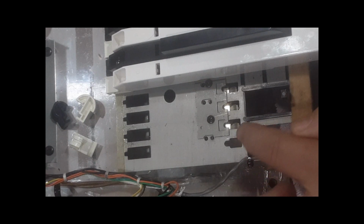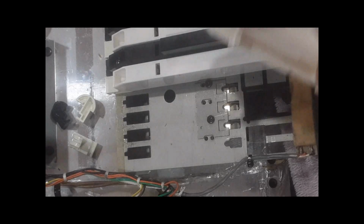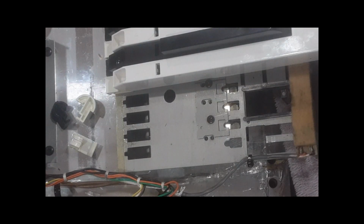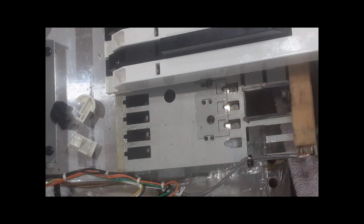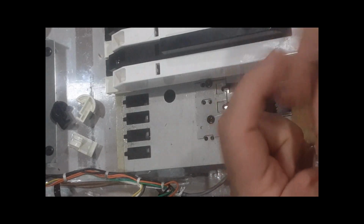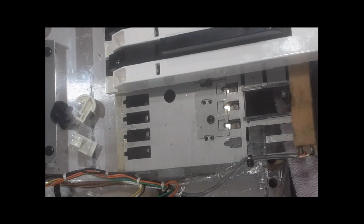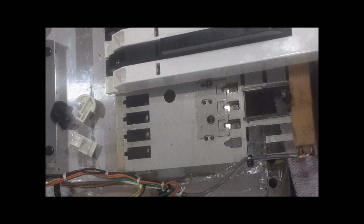And the thing is, if you bend the switch, the key may still work, but you're going to find out that now the switch is misaligned to the nub on the key here, and you're going to say, wow, this key plays beautifully, soft to loud, but the key next to it, even when it's soft, plays loud. That's because you bent the switch, and the switch is breaking and making contact a lot quicker because you've bent things. You can even get it to a point where the key is always playing or it never plays.